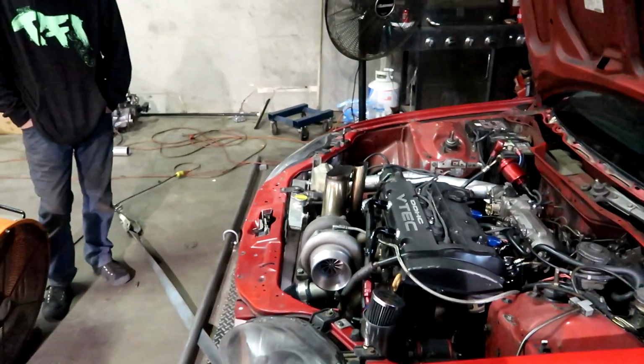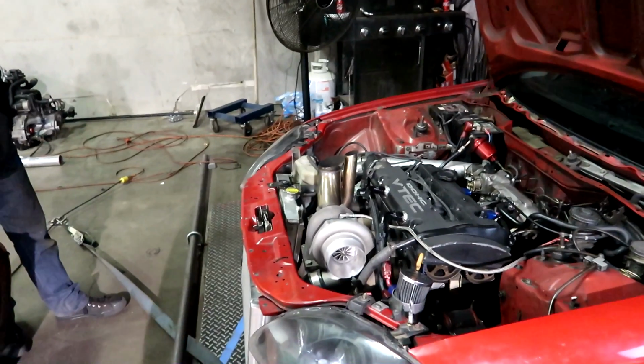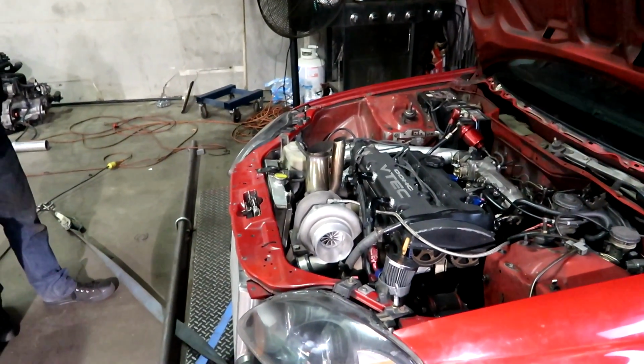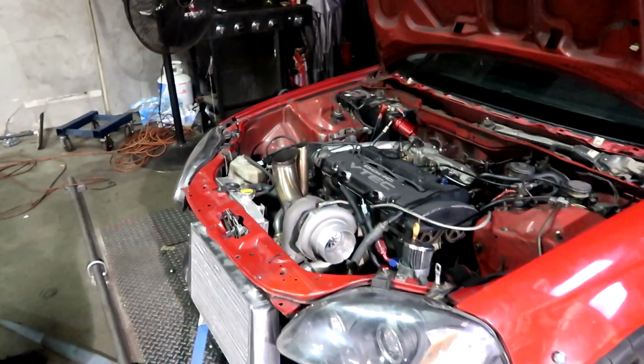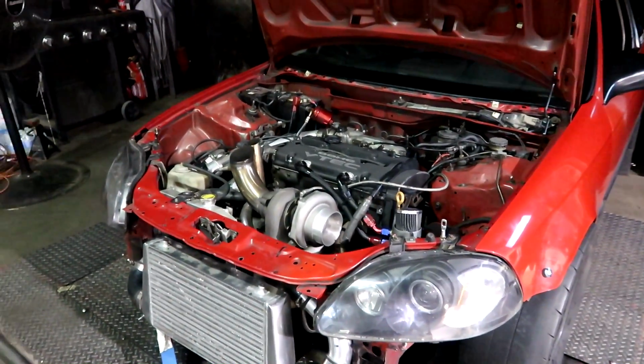Yeah, and the motor should be good. All that smoke was just oil, because once that shaft starts flexing like that, the seals are gonna start pushing out inside of it. So it was just burning oil. I did start the car again and just let it idle and gave it some little revs, and it's not smoking at all. But if you start to rev it up a lot and get that turbo spinning, you'll start to puff some smoke. But yeah, that's how tonight went.